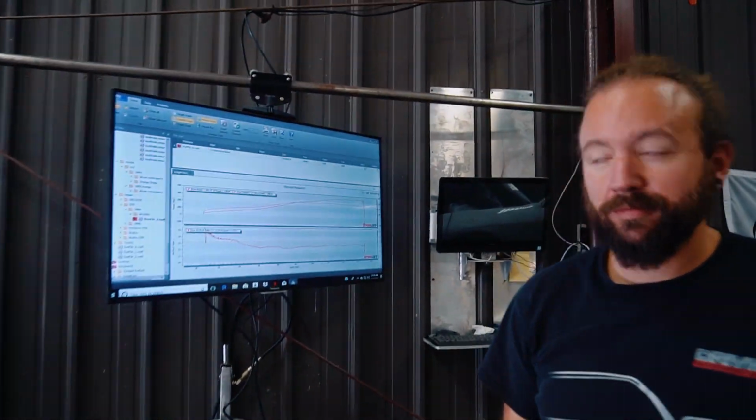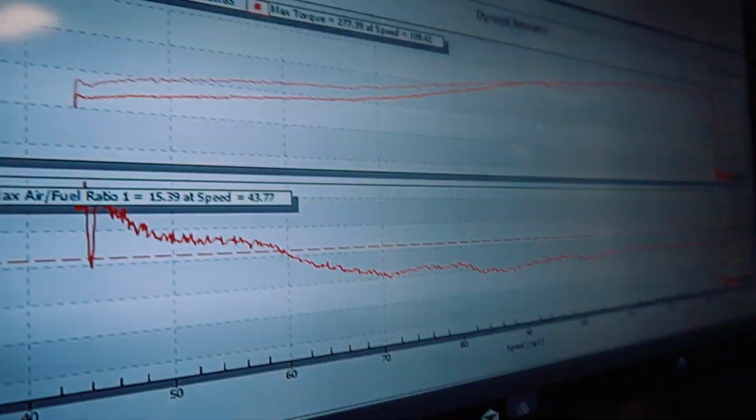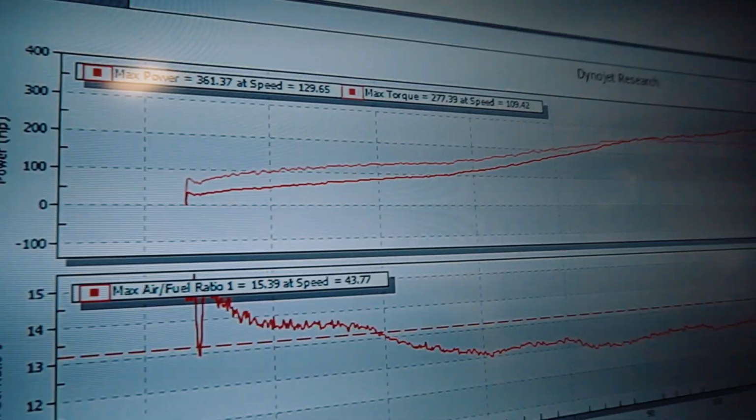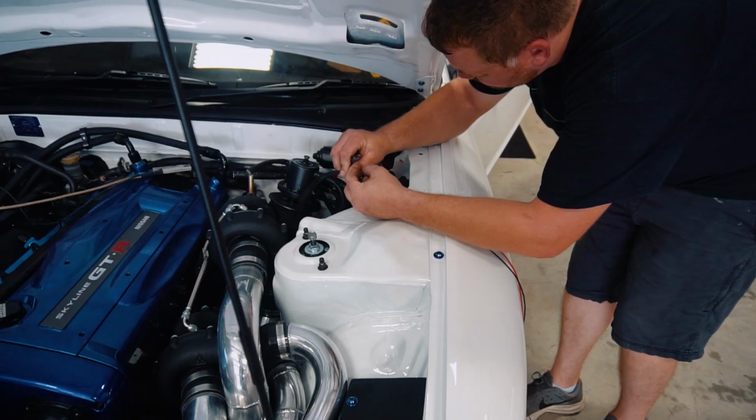So Josh apparently was explaining this bumpy, jagged line on his first pull meant the boost wasn't smooth, just because it makes it inconsistent, you know? Yeah, so it just needs to be a smooth line, basically. Okay. Based on that, I'm gonna guess we can probably get it up to like probably 450, because we got to go up a little bit more on the boost. Like base? Yeah. Gas? Yeah, on gas. I don't remember what any of our number guesses were. I don't either.